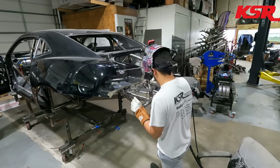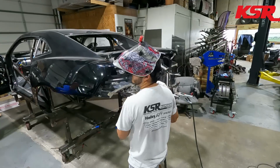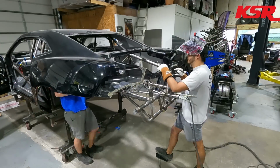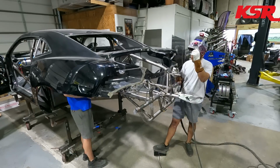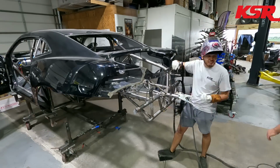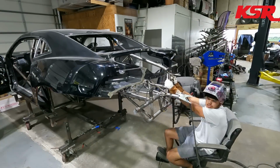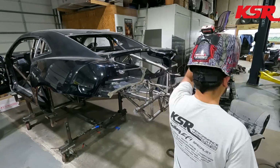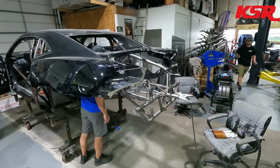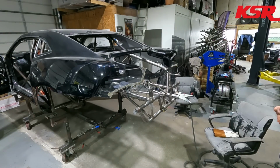And now we're actually into the next day of filming on the car, where Eddie and I took the back bumper off, and there was quite a bit of little welding that needed to be done with the wing strut mounts, like the lower wing strut mounts, as well as the parachute anchor mounts. So he's doing a little bit of welding on all of those, and we're using real low heat, real small filler rod so that nothing moves, and he's welding just a little bit on each one so that none of it gets super hot.